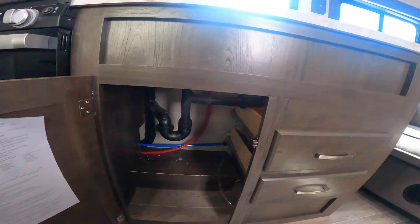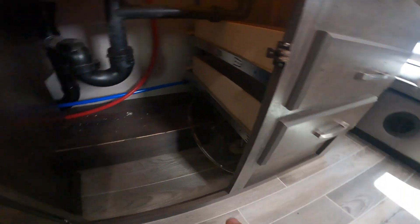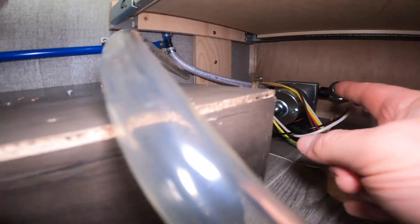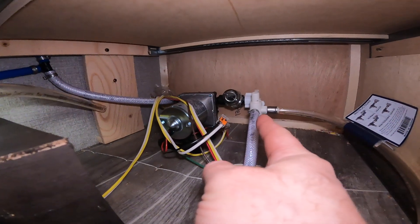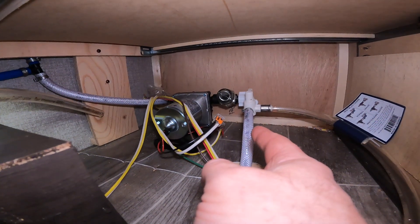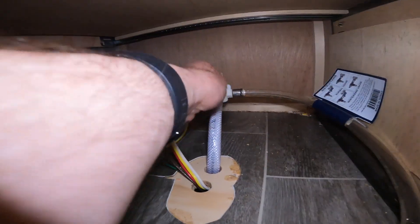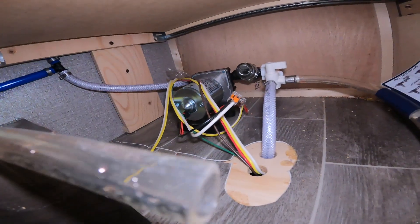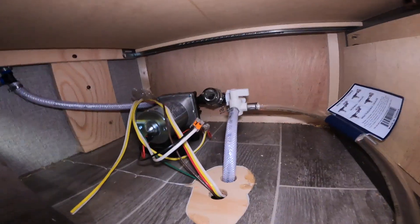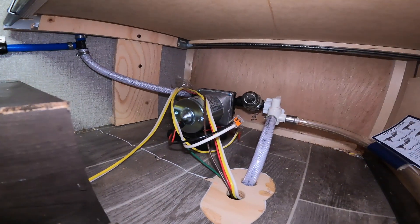We also need to show you where the water pump is. It's underneath your sink — you can get access by removing the drawer or accessing right beside it. There's your water pump, and you can see the valve there, much the same as the valve in the hot water tank I showed you. Currently this valve is positioned to draw from the fresh water tank, as it's pointing back towards the water pump. If you wanted to winterize or use the fill tube, you'd change the valve position so it points in line with that fill tube. We'll turn it back since it doesn't need to be winterized — it's nice and warm out — so this is all set up for summer use.